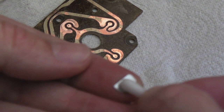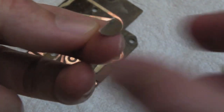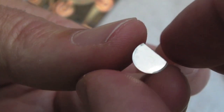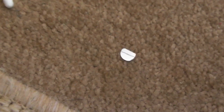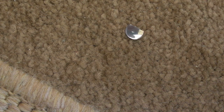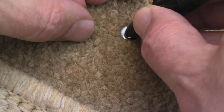I'm cleaning the contacts on the concave side of the blister domes, the same as I did with the Amiga mouse. These domes don't have a single central tip — the connection seems to be made by a slightly raised area on the board, with a little notch on the dome. Since there's no point, I'll place it flat with the concave part facing me and use a smooth rounded tool — something small — to very gently push the dome back into shape, just to give it a bit of tension back without creasing or kinking it.